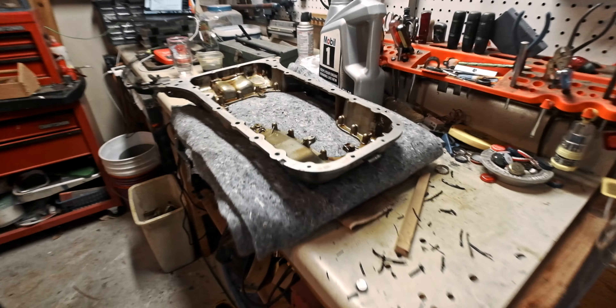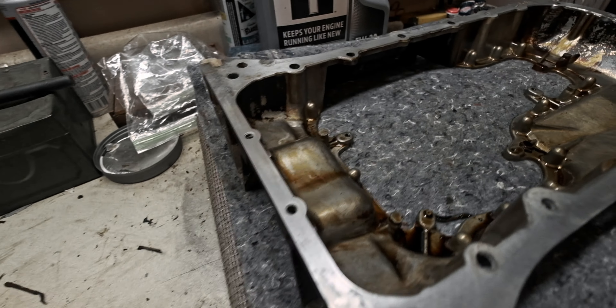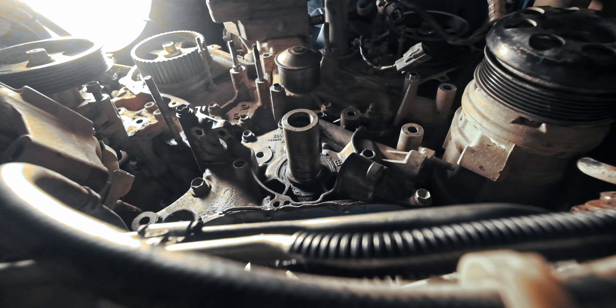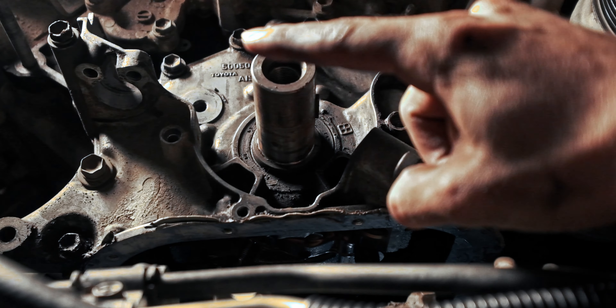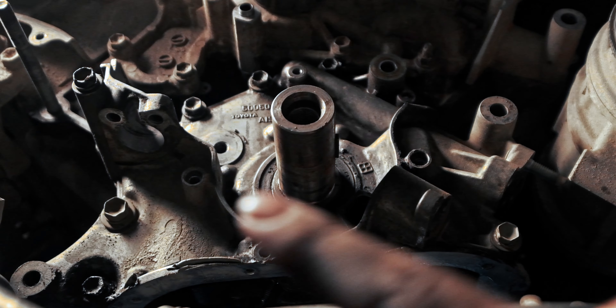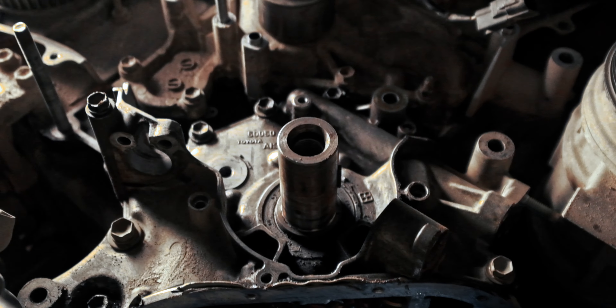Here's all your hardware: oil pan, front diff, pulleys — all that. Here's the number one, or upper, oil pan. Working on cleaning the surface. There are eight bolts total — one is a 14 millimeter and one is a 6 millimeter Allen head.